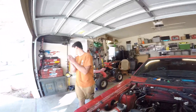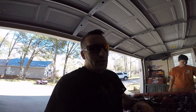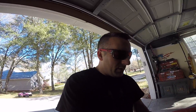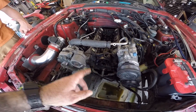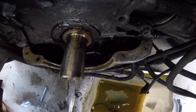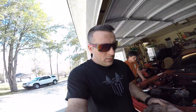And the roller rockers — yeah, so the roller rockers are not going to work out. The bag that I got had about 20-something studded roller rockers, so they're for studs. And the roller rockers I need are obviously pedestal mount. I only even bought the new pedestals from Summit, and come to find out there are only three of those roller rockers in the bag — the rest are stud mounts. So no big deal. Tonight we're going to put in new gaskets — upper and lower intake gaskets, new timing chain cover gaskets, new timing chain, new water pump gaskets. The gasket broke down here so we have to do that whole two-piece deal across the bottom — those corner gaskets that nobody likes to do. But other than that it shouldn't be too big of a deal. Just thought I'd give you guys an update, and we'll pick back up when we get back with some new parts.